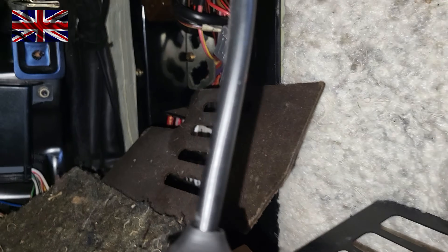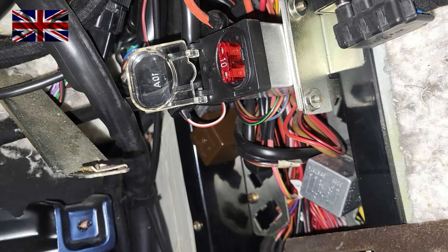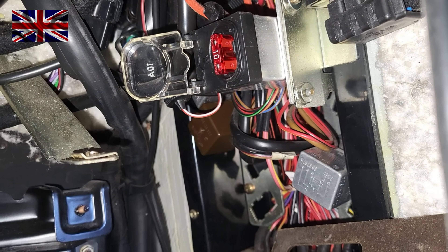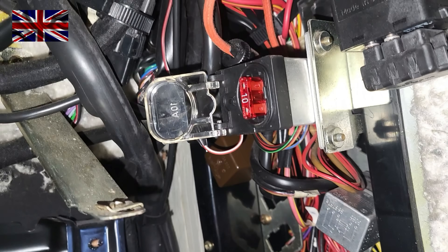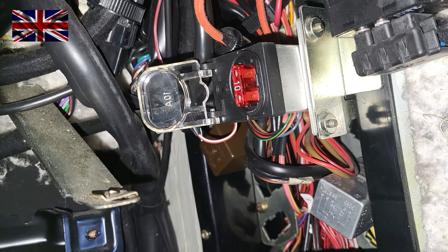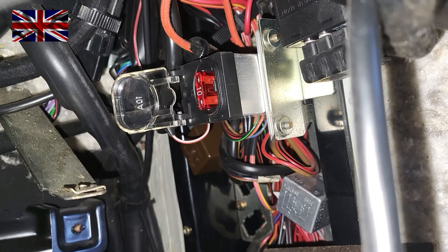In the driver's side footwell: voltage peak protection relays and a 10 ampere fuse — blown. I would have started looking here first, but the symptoms such as high revs when idling did not occur, so never mind. We found it. The fuse got replaced and the ABS light went off right away — job done. While the car was in the shop, I also checked the X92 diagnosis box for codes indicating malfunctions of the SRS and airbag control unit — nothing to be found there either.